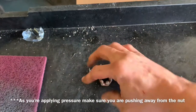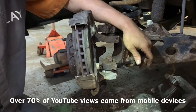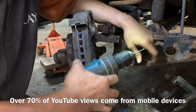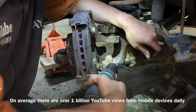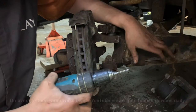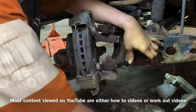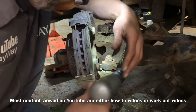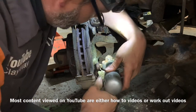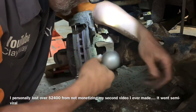Push outward so it glances off and spins that nut. Just in case you weren't able to get that rusty old cotter pin out, I actually took a drill and drilled the cotter pin a little bit — I didn't drill all the way through the bolt but I moved it enough so hopefully it was off the threads. Now we're going to give this an old try and see how she works. Notice that I'm right on the edge of that nut.